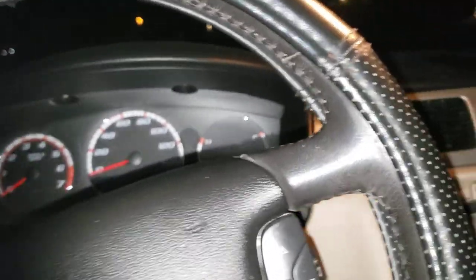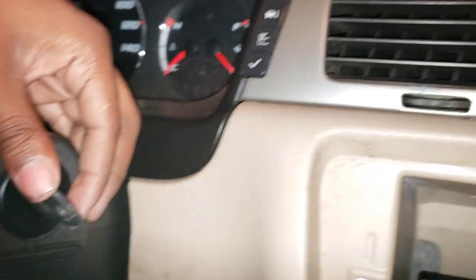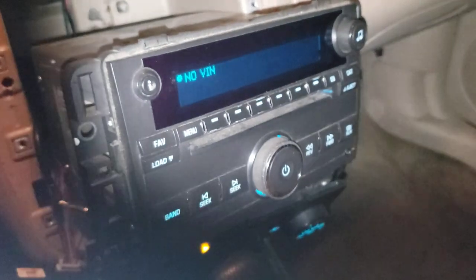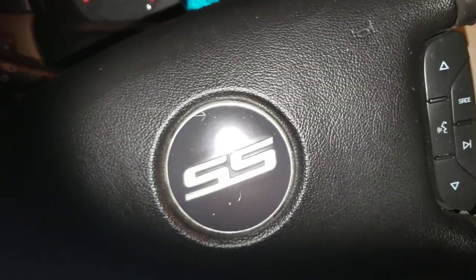I love them actuators. So like I said, you just turn the key to the on position — like that — it's gonna say 'no VIN.' Take the key out, all the way out, open the door, close it again.